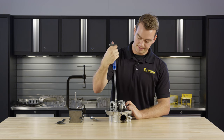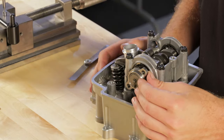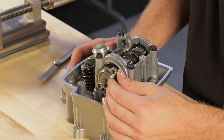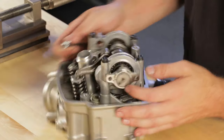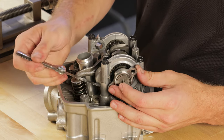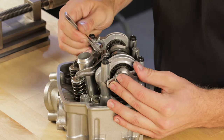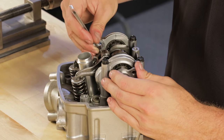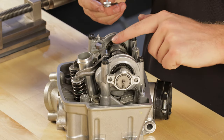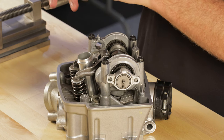Be mindful of where the cam is supposed to be located at TDC on this particular setup. The mounting bolts for the cam sprocket are at about a 45-degree angle, but depending on the year that can change, so take note on your engine where your TDC lines will line up for your cam sprocket. On this engine, the intake valve lash is set at about 6 thousandths of an inch — that's within spec. Make sure the cam is in the TDC location, then use your feeler gauge. That one's a little tight so we'll need to adjust it. The feeler gauge should slide through with just a little bit of friction. The other intake side is at about a 5, which is still within spec, but we might loosen it up just a little bit.